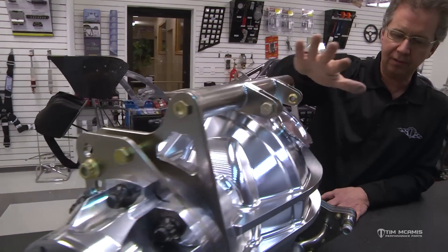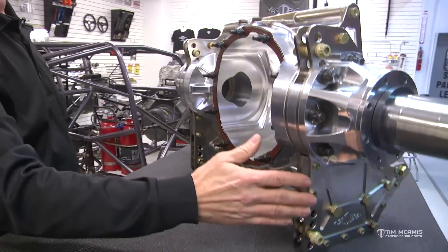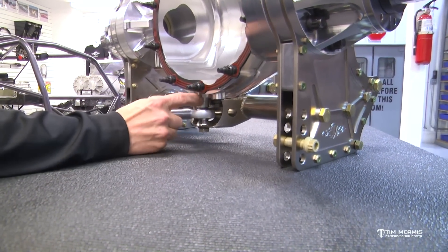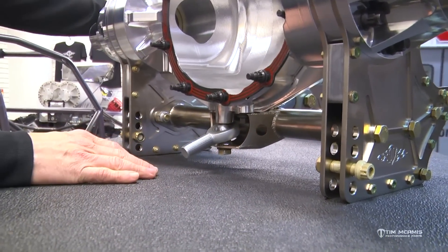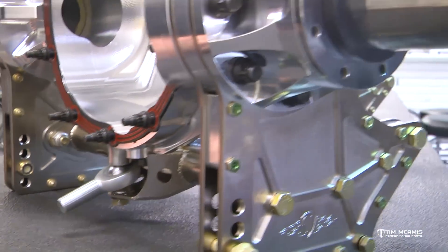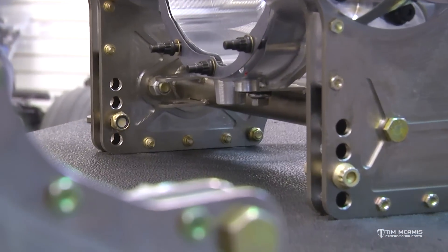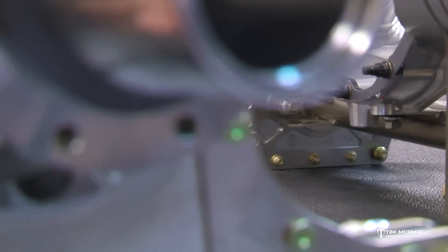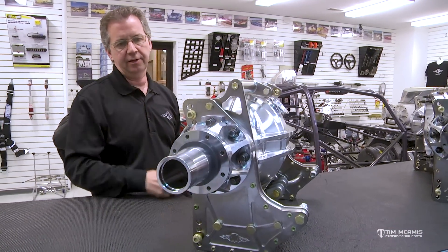The sway bar mounts are built into the brackets, you've got your tab up here for your brake line, upper wheelie bar mounts — all the brackets are pocket milled. We do a lot of extra machining on the brackets to get that pocket milling in them. They all come with the center wishbone mount bushing, so you can use that, or if you scan back to that housing, you can see it has tabs for the wishbone to be flipped around the other way. We've got a lot of options to mount the wishbone with the wide part at the housing or the wide section at the chassis.